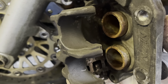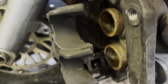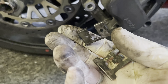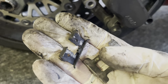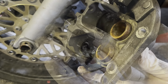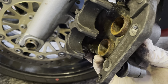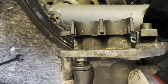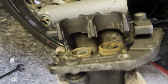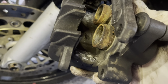We'll get those corroded pistons out a bit further — maybe even out completely — clean it up and it should be a world of difference. This is the other part we'll clean up; they're all kind of mucky and greasy. These are the slides that the ends of the pads slide across, so we'll give them a good clean up as well. I'm going to pull the brake lever gently — not so they pop all the way out — just slide them out a bit. That is interesting: if you hold it like that you can see one is sitting proud. When I pull the brake lever gently, one of them moved and the other one didn't. So what I've done is put the pads back in with no disc and squeezed them until both of them came out.